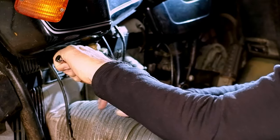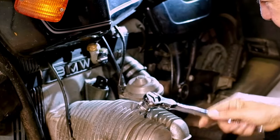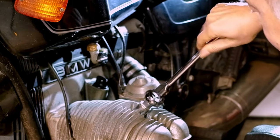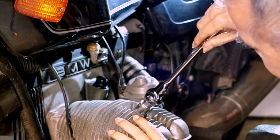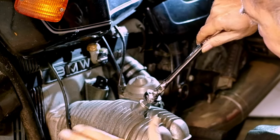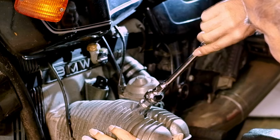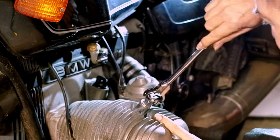Let's try to get this off now — that's 25 foot pounds. That wasn't too bad. It is shorter but it's not too bad. You can see the back drag test again — fresh spark plug, the engine is a working functioning engine, nothing's rusty, well lubricated, basically clean parts. And you can see that the back drag is way too strong for this — it's just going back and forth, it's not making any progress.